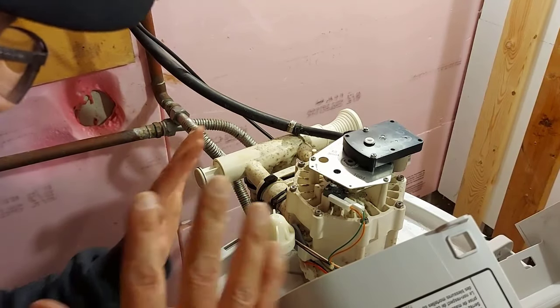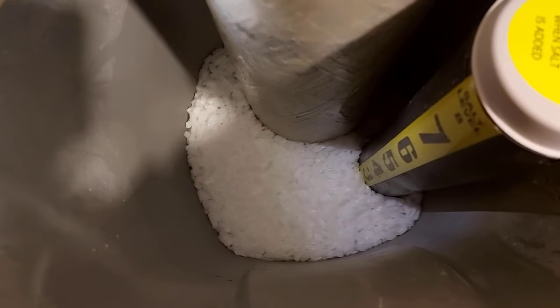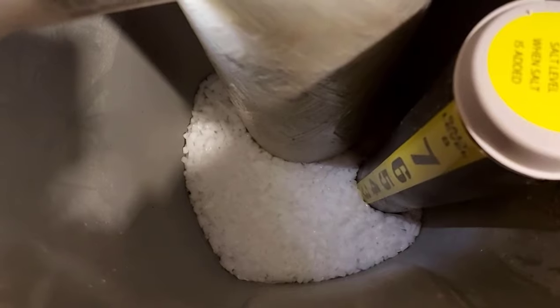We're back — the water softener has done its full cycle, which took a couple of hours. I just looked inside and guess what: there's no water! Look in there — no water. You can see where the water level was, and now it's all gone, just wet salt. So the problem was that gasket. I did some research online and found it could be the problem, and it turned out to be exactly that. If you're having a problem with your water softener holding water and it's not leaving, check that gasket — but also check everything else I went through in the video. If this video helps you, hit that like button and don't forget to subscribe.